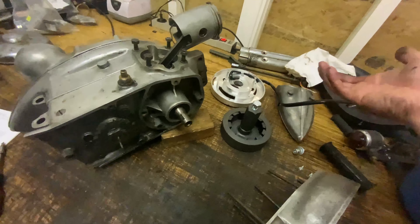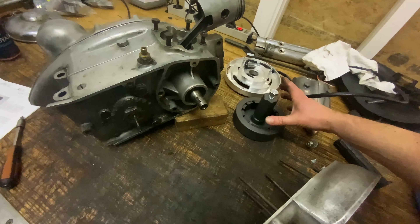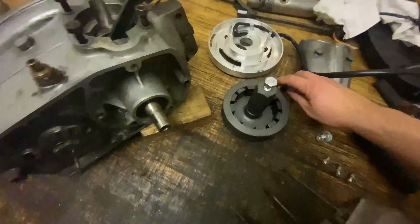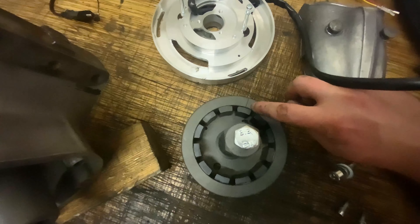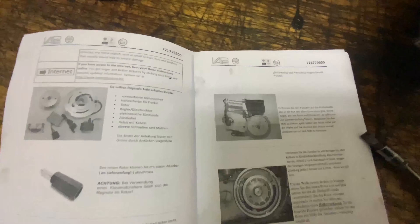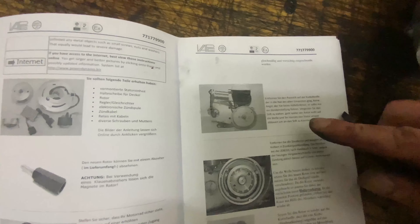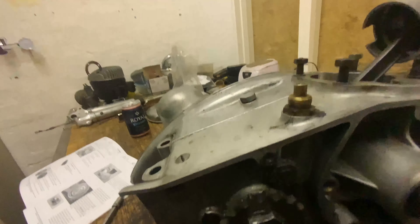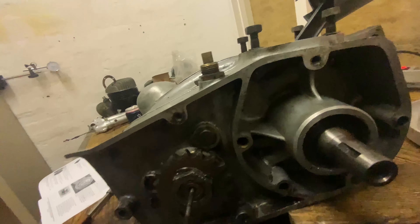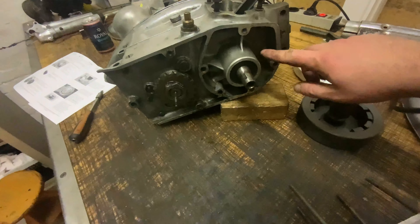It's a little bit reversed compared to the original, and on the inside you have the big magneto. There's a nice little stamp here for finding the ignition timing, and in the instructions there's a picture of an RD engine — same stuff — and you can see there's a marking there, but I've not been able to locate a marking on mine.